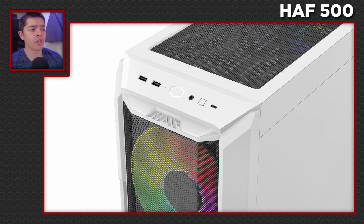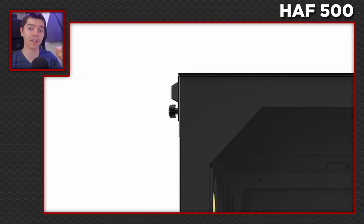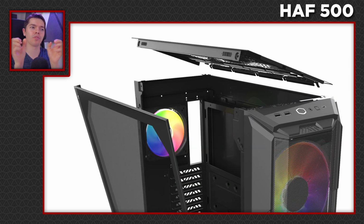Anyway, they have USB 3.2 Gen 2 Type-C support for the I/O, which is great, and the glass side panel has a screwless and tool-free TG side panel design. That's what they're calling it. If this is anything like the NZXT H210i side panel, which it looks very similar to, with a captive thumb screw and a very small tab up top to pull it off, it will be bad. But if they've tuned the strength of the ball and sockets that hold the panel on in the first place, it might not be so bad. So it depends on how firm that ball and socket system is.